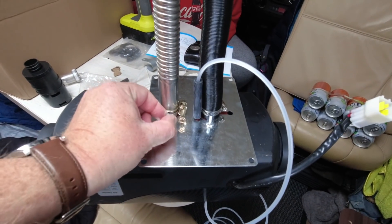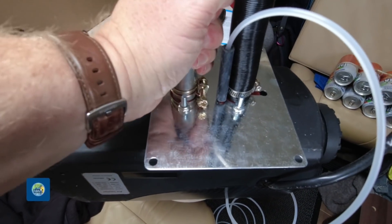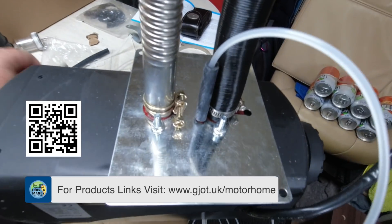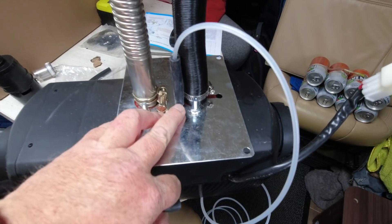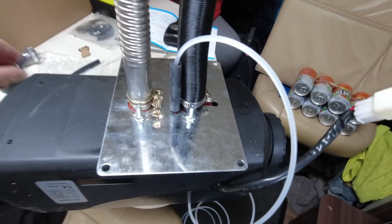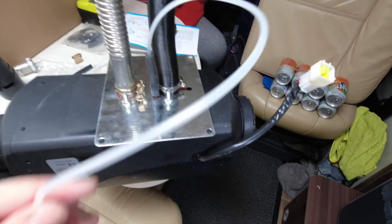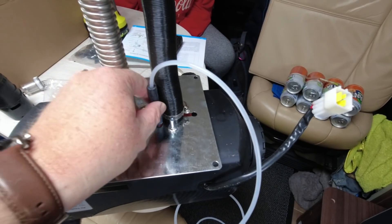We've installed the plate, all bolted down with 10mm bolts. There's a double clamp on the exhaust because you want to make sure that exhaust is really well sealed — nothing's coming through there, that's why the double ring clamps are on there. Standard jubilee clamp on the air intake, then there's a sleeve that goes over the nozzle on the diesel heater. The reason the fuel line is so tiny is that it regulates fuel flow, so if you change the fuel line, make sure the last bit to the diesel heater uses as much of that tiny diameter as possible.